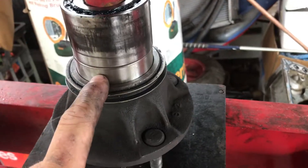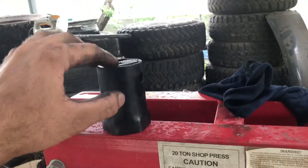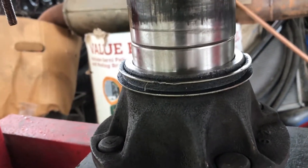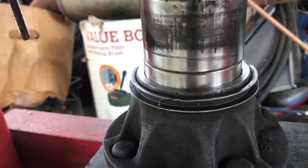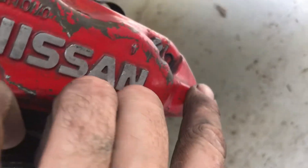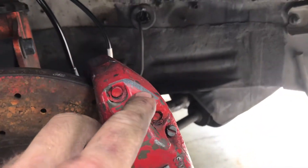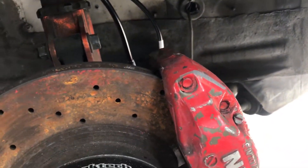Press it in so you don't damage that surface at all. These are a perfect fit, so I'm just going to go down to that level, pull it out, and swap it out for a big old socket. The other side was dragging a little bit, and I just skimmed off a small amount in those areas. This side just touched, so I figured I'd just nip it off — only one or two passes with a flap disc, nothing serious. It'd be less than a millimetre, but just to be safe so I'm not stuck on the side of the road. Just cleaned it up.